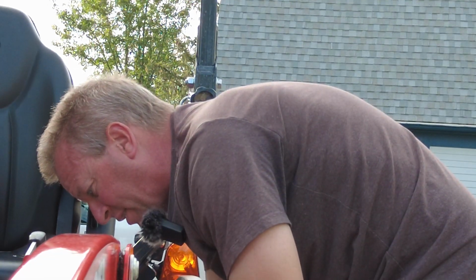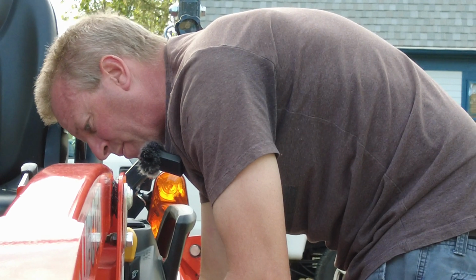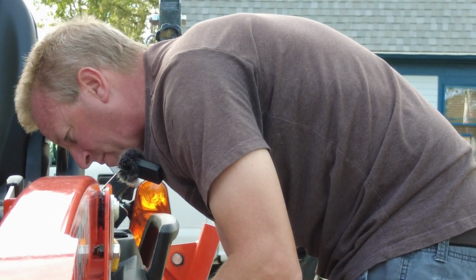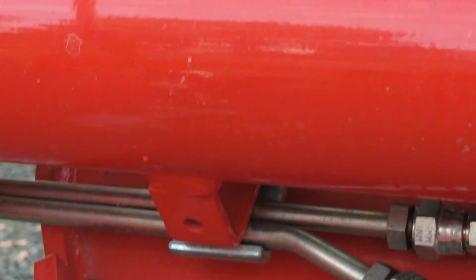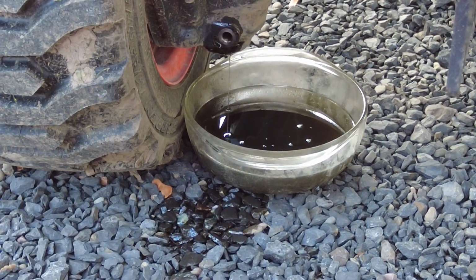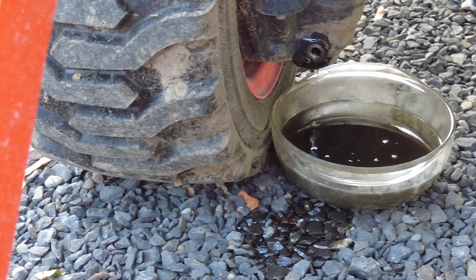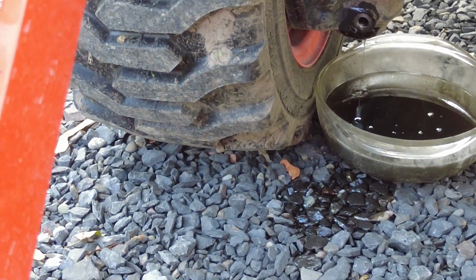Alright. Axle maintenance. Let's go back to 117, that was capacities. 119. Front axle takes 3 point... Yep, so it takes 4 quarts. Front case. Alright, so we'll get the other side in and we'll add those 4 quarts.